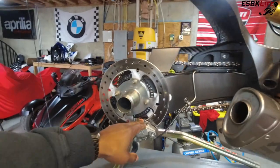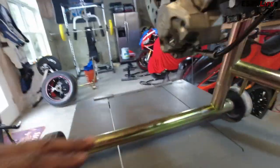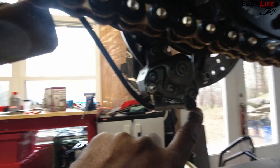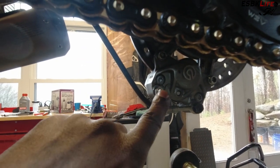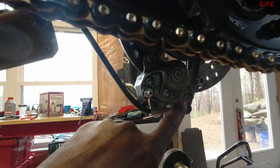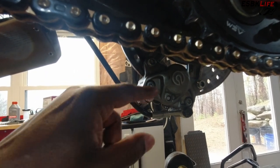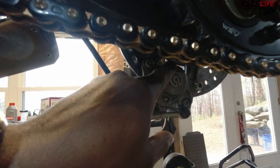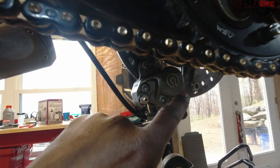What I wanted to show you was a trick that I found that almost instantly worked for me. So as you can see, the caliper is fairly flat. You can see where the fluid enters — it's entering at the lowest point — and then the bleeder valve is not at the lowest point because the piston is up here. What happens is fluid comes in here along with air, and air gets trapped in the piston up in here. So when you're trying to bleed, you can get fluid out, but air doesn't like to travel downwards. Air is lighter than fluid — it wants to travel up. I found that air was getting trapped in this piston, and the way I resolved that was like this.